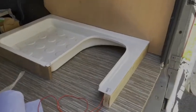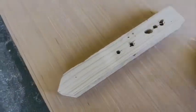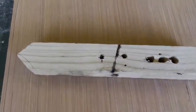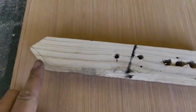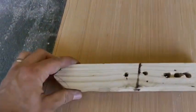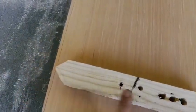is we're going to start putting the walls in. Now, to get that contour, I'll show you my special tool, my scribing tool, available in all good campervan retailers. So these are renewable, you need to keep changing these every so often, but basically push your full size board in against the wall, and obviously because the top is narrower, you can see this one's already been done, it won't push all the way in. So measure the gap, how far away it is from the bottom of the wall, and that is where you need to put your pen in.